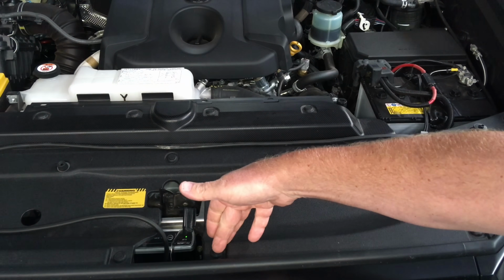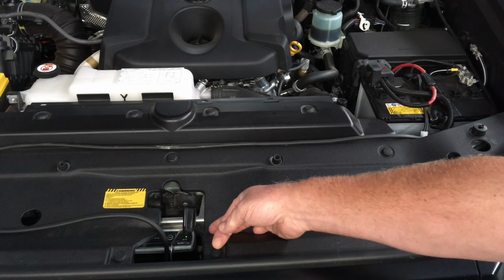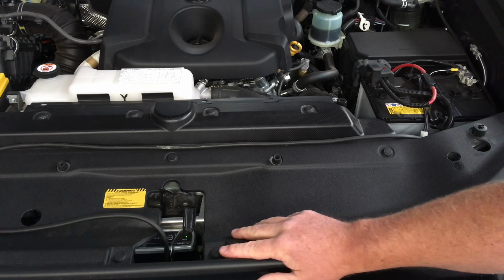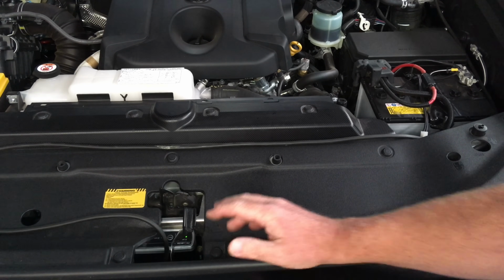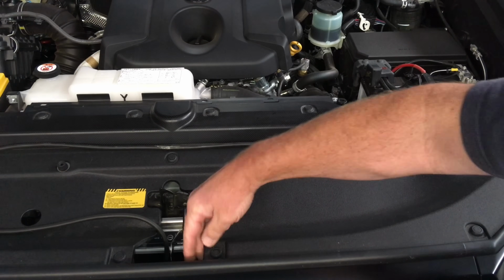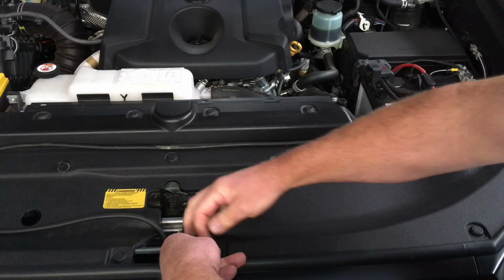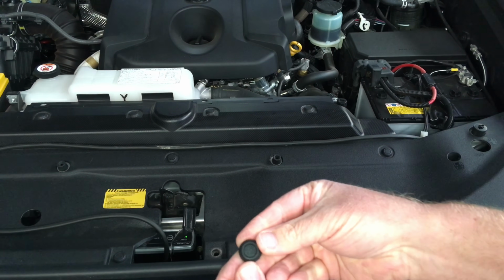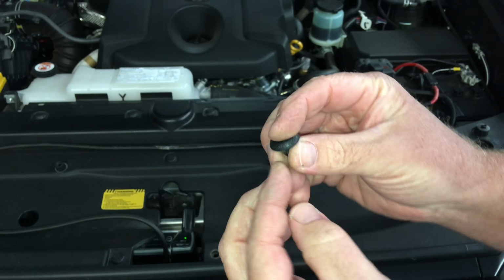But what people do, they put the screwdriver under and they want to pull the center, and they sort of wreck them. Then they're bent up at the edges, then they're not sitting flat, and then people just want to press them flat, and they kind of go in too far, because to release these clips, guys, you press them like that, and then they come straight. And what happens is, then you're driving along. Of course, this one's not going to come out because it's nice and new and well looked after. See, it's pressed down, about 1 millimeter or 2 below.